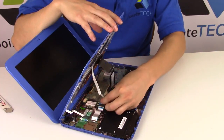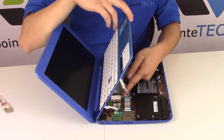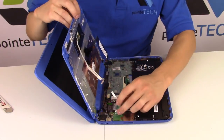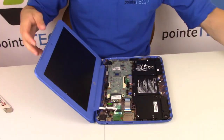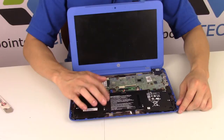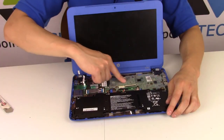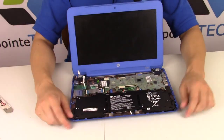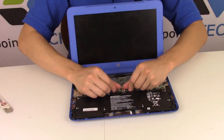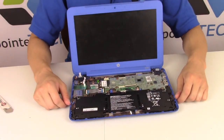If you had not just ripped it off like I did, you put these little plastic pins up and slide them out. Now, one thing we always do at Point Tech is unplug the battery first. If you're poking around with a screwdriver in here — they have a protective covering over the motherboard but some boards don't, and there could be holes and you could touch something, spark, and wreck your motherboard — which you may not care about since you're replacing it anyway. Take off this little piece of tape, slide your battery clip out. Don't pull on the cords because you can pull it off the port. Now your battery is unplugged, so we're safe.